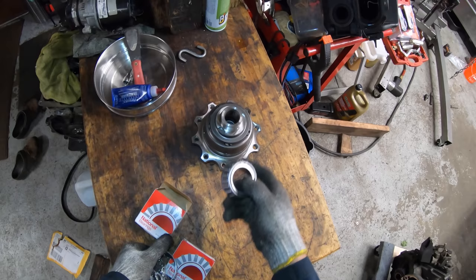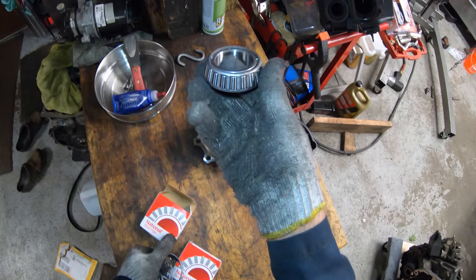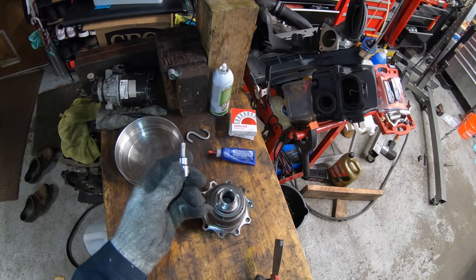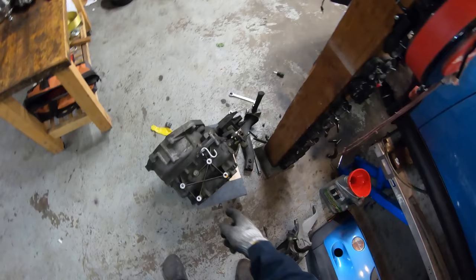The differential does not come with bearings, so you'll need a couple of those — you'll need two of them. You might be able to pull the old bearings off your old differential, but it's probably safer to just buy brand new ones. I'll put a link in the description where you can get these as well. You will also need anaerobic gasket maker to reseal both sides of the transmission. We take apart the transmission using a Torx 40 socket, and I have a scraper here as well to scrape off any old gasket material.